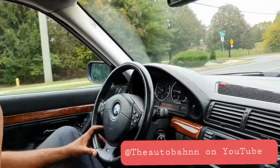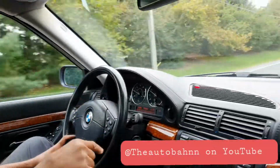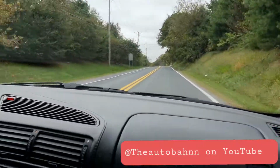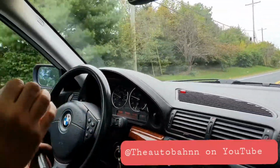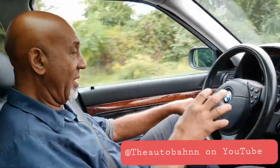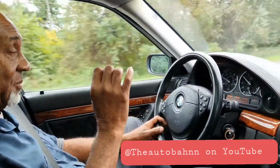So I took the Vanos off, timing chains and all that, and sent the Vanos out to Dr. Vanos. He rebuilt them for me. New timing chain, new tensioner, new OCV valve, everything on the front was new. I put on new spark plugs, new coils, everything. And then I started to tackle the leaks.